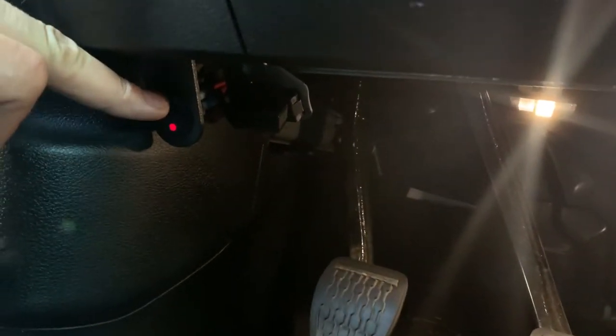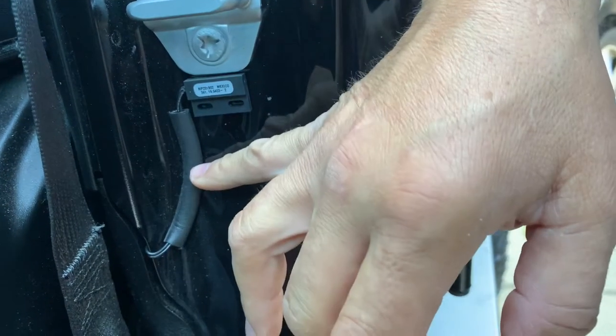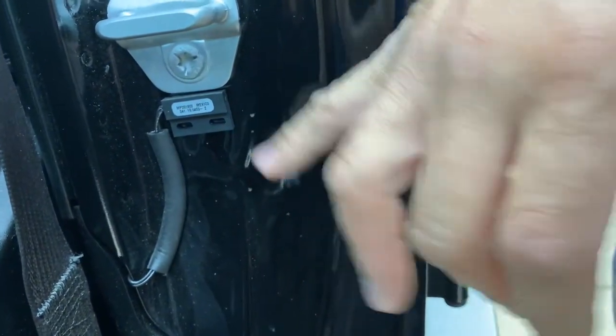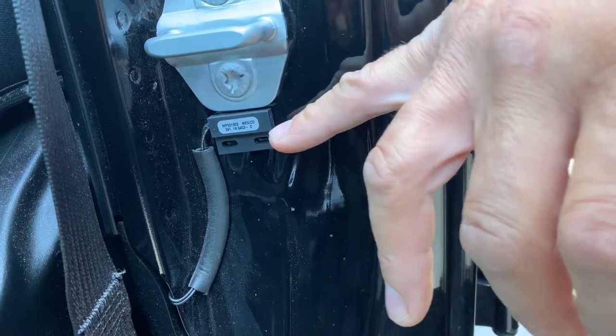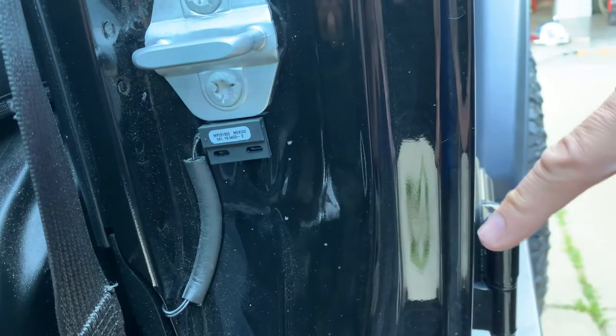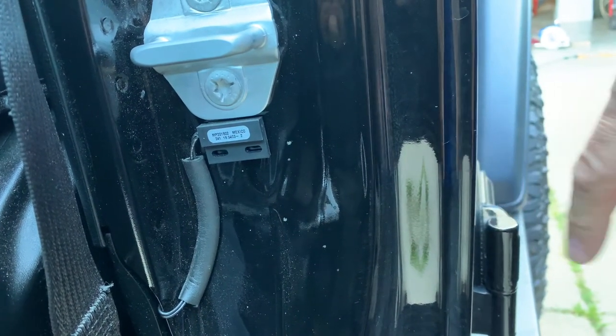So the wiring comes through, and you mount this switch into that bracket — that allows you to turn the steps on and off. Then just run your wire up underneath there and tie-wrap it all up; it'll be nice and clean. The nice feature of these steps is you can turn them off so they don't have to come down every time. All the doors will get the switch. They give you a nice little insulated piece with double-sided tape right underneath the latch, and good measuring directions. The switch is wired up to the main wiring harness, and Rockslide gives you a good diagram of where to place all these sensors.